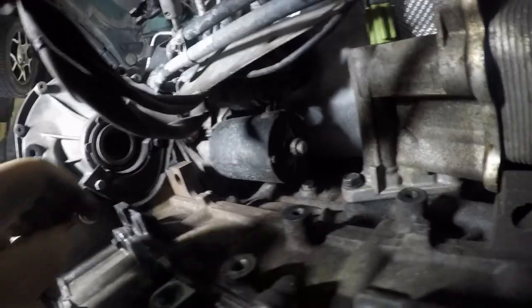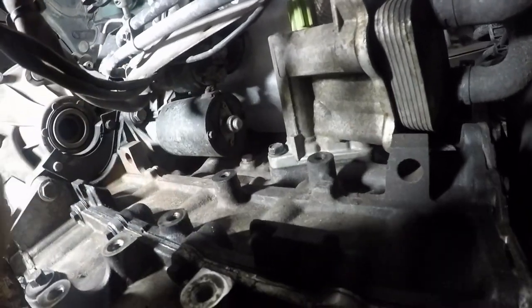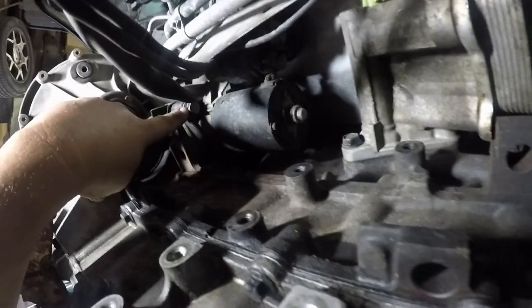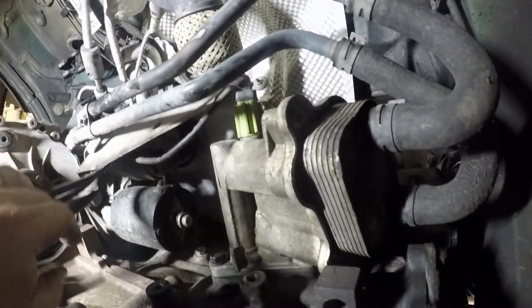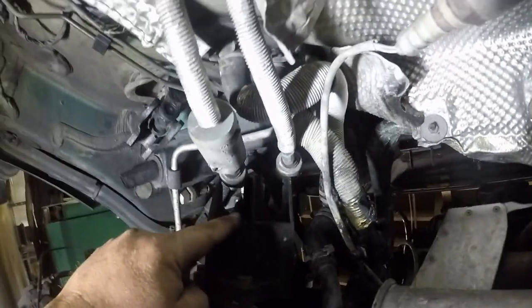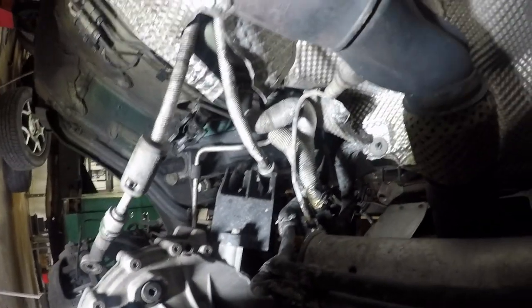Welcome back. Here we are on the nice cozy underside of the car. I've already taken out the half shaft and the carrier bearing — that took literally moments. Once the subframe was clear that job is actually real easy. Here's the starter motor under here, and there's a bell housing bolt right there, and I'm assuming there's another bell housing bolt maybe on top of the starter. Also, there are linkages here — there are clips in this bracket that you just squeeze together and these push out. That's how you take the linkages out.